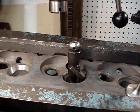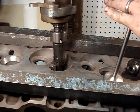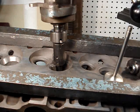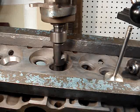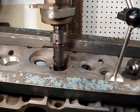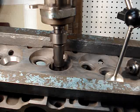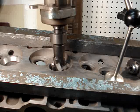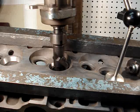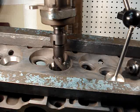We'll run our cradle over here and I'll kind of show you how this works. We're going to center our air table here. I like to get this tool right on the work and then kind of free the table up so it centers itself. We'll just start making a cut there, cutting that throat out. You can see how this tool is just relieving that throat, opening it at a taper, of course, because we want the throat to taper out up to the valve seat — keeps the air velocity up.